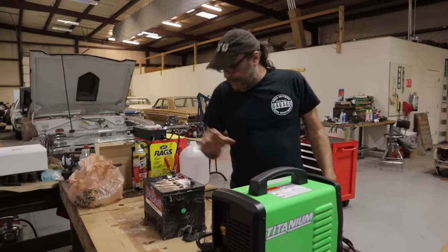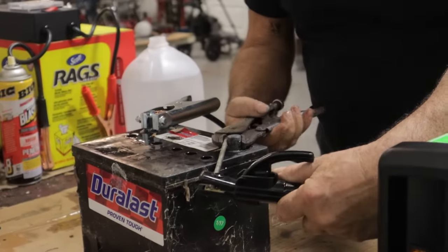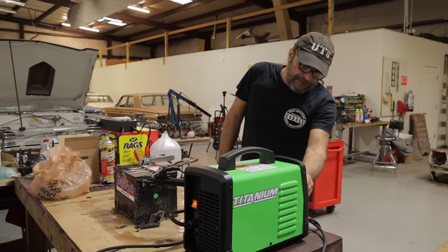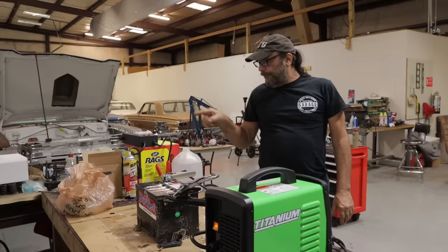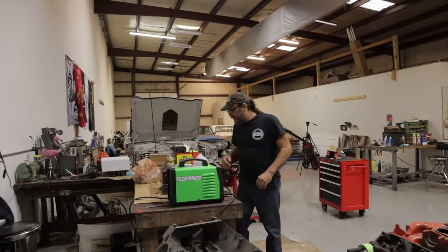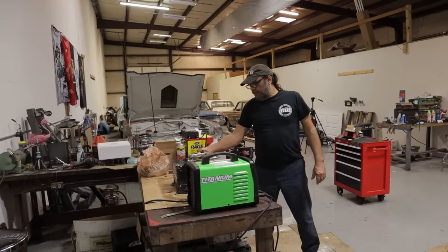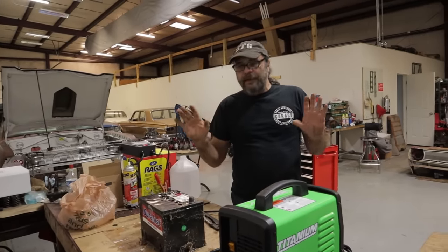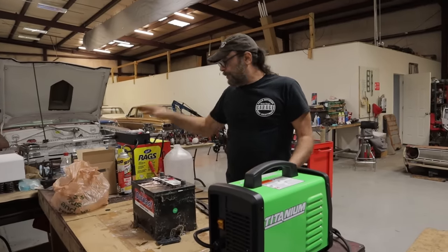She sat for about 15 minutes now and we're going to re-hook everything back up. Positive. I'm going to fire this thing back up at about 100 amps and let it percolate for five minutes again. Then we'll check it with the load tester. Okay, that was five more minutes. I'm going to shut this thing down and pull our connections off. We'll sit for another 10 minutes — I think I'll come back and give it one more five-minute zap, and then check out the load tester.